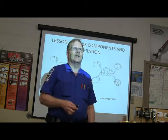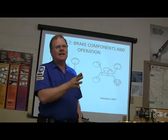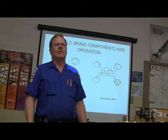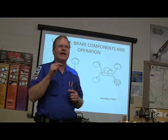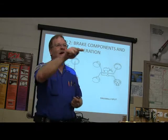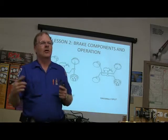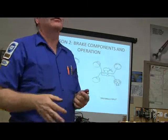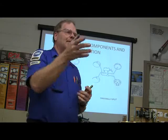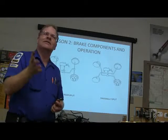So we got it up here for some reason or another. We decided we were going to fool with those brakes. And so I looked at the procedure for bleeding the brakes on that Nissan pickup of his, that Titan, I guess it is, or maybe a Frontier, I don't remember, but the long and the short of it is that white Nissan he's got. The brake bleeding order was weird, something you would never have expected, and it didn't follow that old right rear, left front. It actually was a totally different order. And when we bled it according to the way that Nissan said they were supposed to be bled, they were rock hard and perfect. Well, they never had felt right because the people, probably at the body shop, did the plain old standard pattern. So make sure that you know how things are supposed to be bled before you do that.